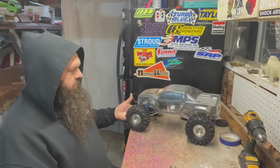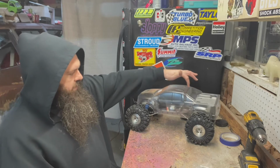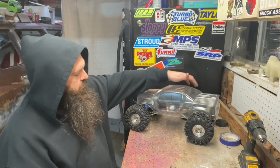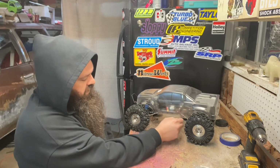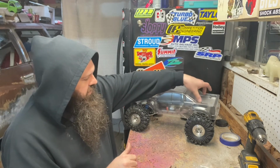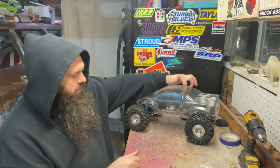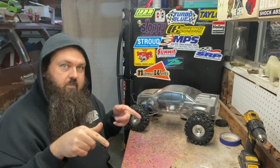I think what I'm going to use this roll bar here as like a rear body mount. So I'm going to cut it here and cut this all off and just use this rear body, or this roll bar, I guess. And I may cut the bed sides off and I may leave them and just pinch them in, and I'll cut all this stuff off, and I'll probably cut the bed out and then chop the tailgate and then bring everything in, and I'll use the actual roll bar here in the body. I'm gonna try to carry that over into some brake line and make that my main rear hoop.